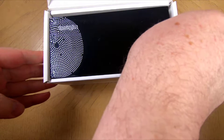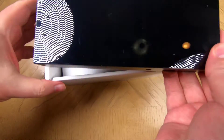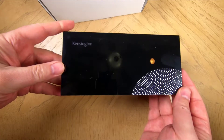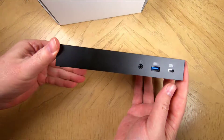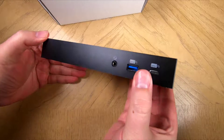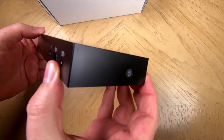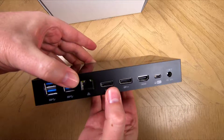We've done testing with it and it's got driverless USB-C connectivity that allows users to transfer up to 10GB per second — video, audio — and provides up to 60W of power delivery via a single cable for a simple plug-and-play experience with no drivers needed. The host device must support power delivery and DisplayPort alt mode over USB-C.